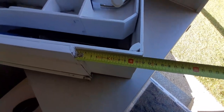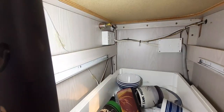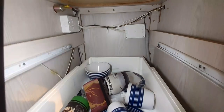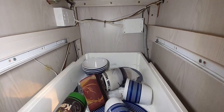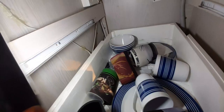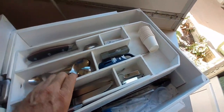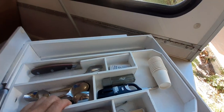I've raised and lengthened it 12 centimeters there, because inside there's plenty of room. There's the 240 outlet there so that one has to stop there, but I've raised the second drawer 15 centimeters - that's giving it heaps of room. I wanted to get rid of this because it was too noisy. That was a great advantage doing that - you can get a lot more stuff in there, as you can see my drawer's full. I got this made up so we can keep all that in there and still have access. Just a matter of putting some wood slides there, and I made this out of 6mm ply.